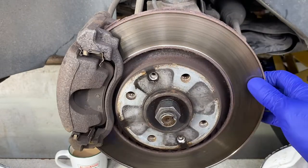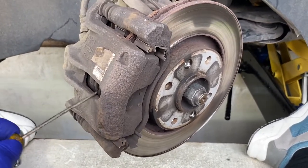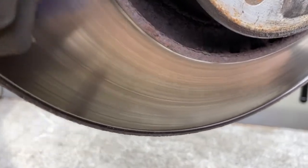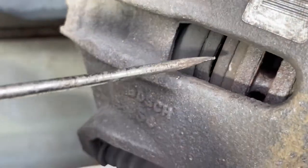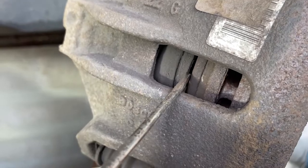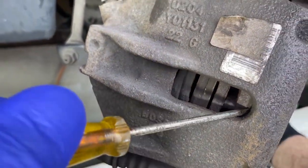Remove the pliers. So now the disc should be quite free from the hub. I'm now going to put the steering on full lock. In order to get the disc off, we've got to get it past the brake pads which are in the caliper here, but there's a lip — that's why I'm renewing this disc. There's about two mil lip all the way around the edge of this disc; it's quite heavily worn. So we can just feed a screwdriver in there and push the caliper piston back, which will allow movement on the pad.